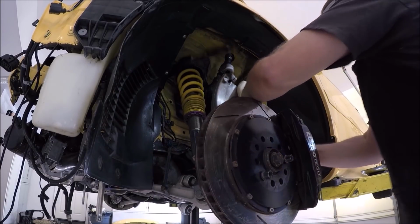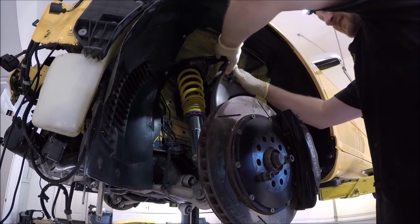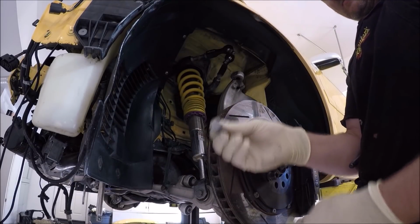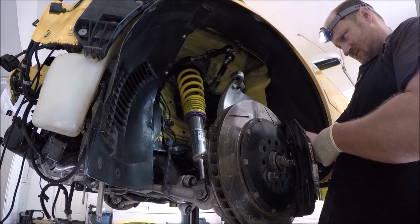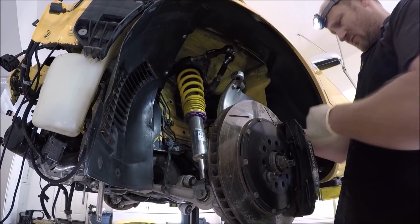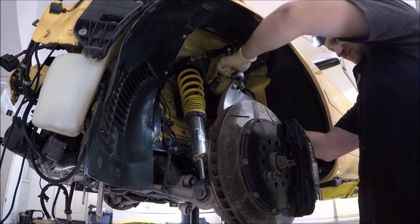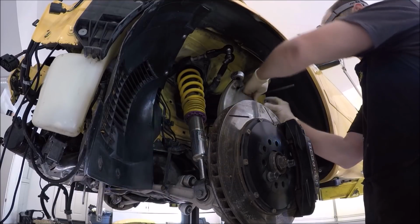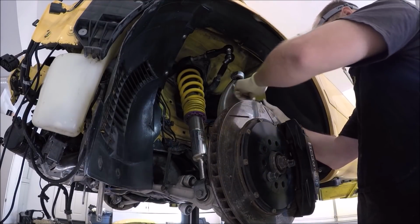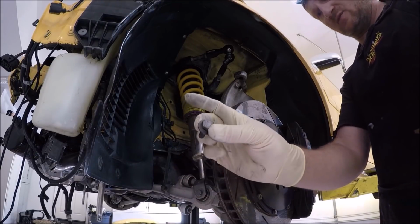First, we're going to start with the outer tie rod. The reason why this upper control arm was on is when I was doing the axle, to keep everything tight, I just stuck that in there to help out. This is for the tie rod, 16mm nut in the specialty. Comes in from the back. Now this flat part is towards the front of the car. And the bolt won't come in, so I use a 10mm Allen on the top, and I turn it until the bolt goes in, like so. Put this 16 on, tighten her down. There's also this 13mm that goes on the top.